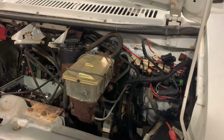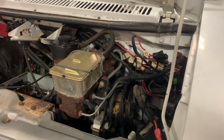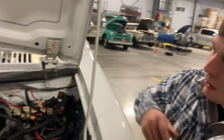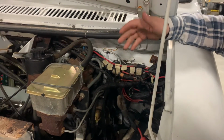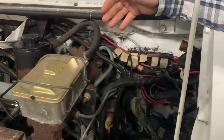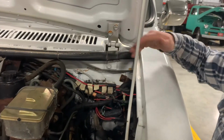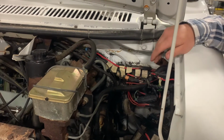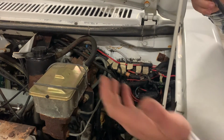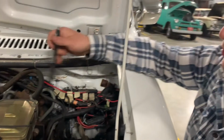Hydro boost was initially invented for vehicles that were operating with a low vacuum, such as a diesel engine. The point of a hydro boost is to produce boost without the use of vacuum. They oftentimes use the power steering system as their source of pressure. You have an inlet hose and an outlet hose, return hose, to the power steering system. And the pressure hose brings pressure in, and when the brake pedal is pushed, it moves a valve that will apply pressure to the master cylinder.